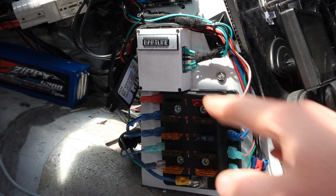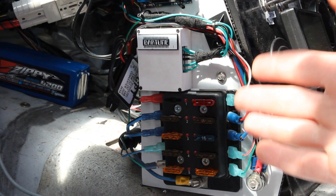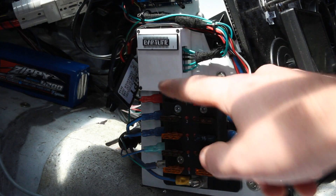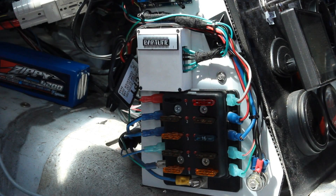By using this we're able to control the pump via the ECU based on current coolant temperature. You could even use more clever stuff — control it based on certain RPMs or manifold pressures. We don't really need that in this case, so this controller board does all of that work for us with the help of the ECU. The ECU is outputting a 12 volt signal to this, which then switches that using a big relay — our nice big solid power source — straight to the pump.